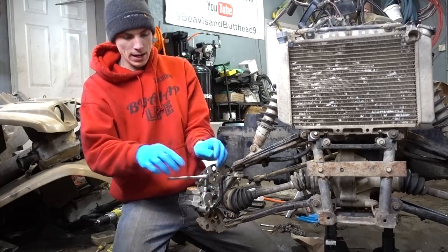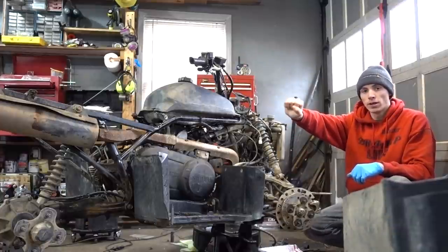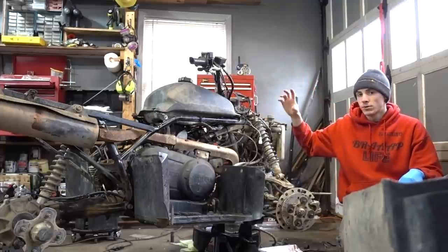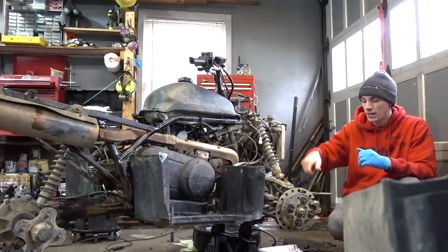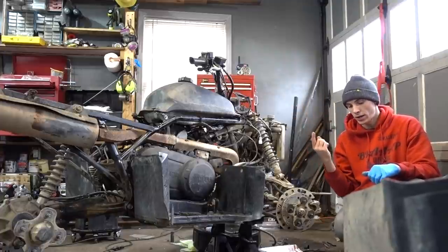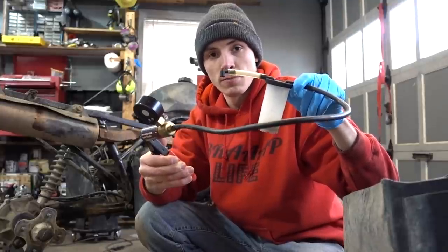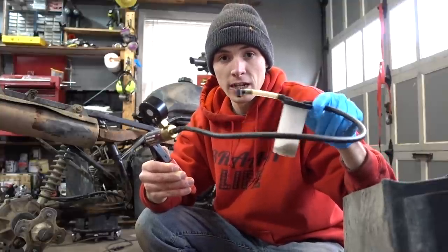You have to get all the air out of the line so that it works like a hydraulic system. So right here you have your bleeder. Now on four-wheelers, sometimes you can just play with the brake lever — pull in, let go, pull in, let go — like a couple dozen times. And sometimes it will actually bleed itself because air wants to go up where fluid wants to come down. You know, density. And then there's other times you have to do it like a vehicle, where you actually push the brake in, undo the bleeder screw, tighten it back up, and release — and do that process over and over again. Or you can get yourself a bleeder vacuum pump kit, and basically you let this do all the sucking for you so it sucks the fluid from the master cylinder, which is up top, and brings it down to the caliper with a nice steady flow of fluid.